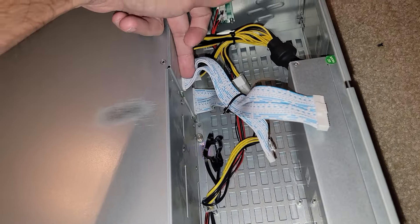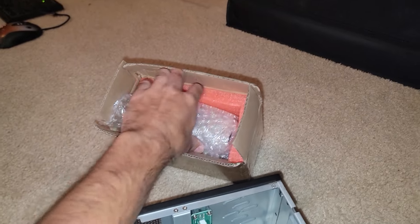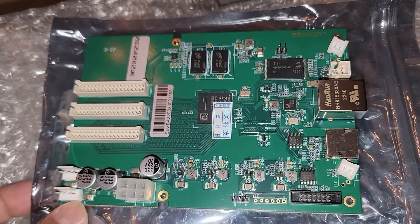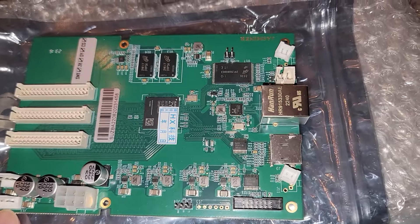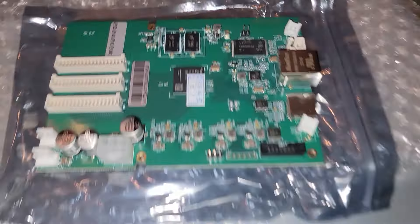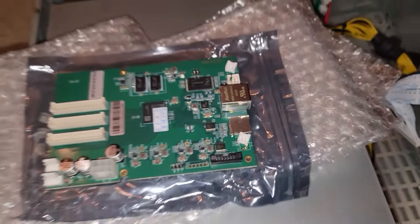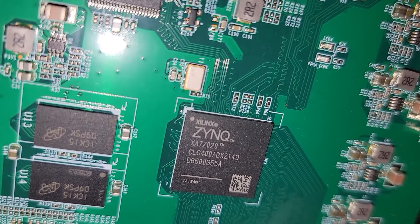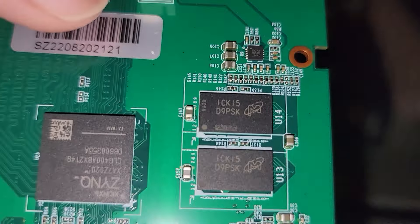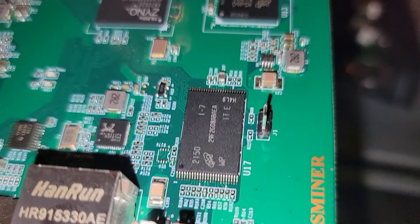That will allow you to remove this outer shell and gain access to the hash boards. You just need to unplug the ribbon cables here and here, and then the power cables up top and in the bottom. Here is our new control board — the components on this look brand new. I don't see anything that sticks out like long-term usage. Here's the old board, and they look pretty much the same. They even have the same markings. This little sticker here is on a chip which I believe is a Xilinx Zynq chip — the XA7Z020. And I believe these are our memory chips right here: ICK15D9PSK — they're Micron. Micron memory chips, and that other one is also Micron.